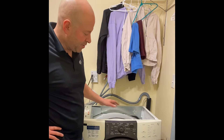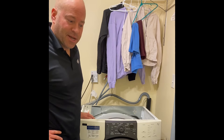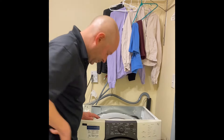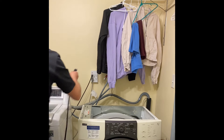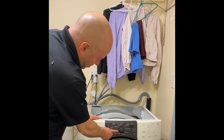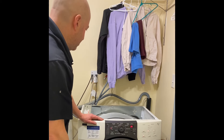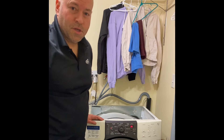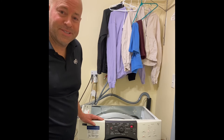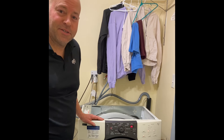I'm at a safe stopping point — I've turned the power on and the gas on to make sure it works. It looks pretty good, so I'll button this thing up. This all happened because my kids were doing laundry with towels and tennis shoes, but I'm okay with that. A new belt and a new motor pulley and we're back in business.